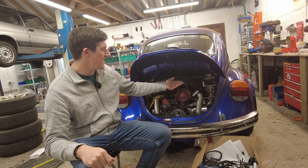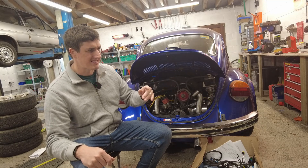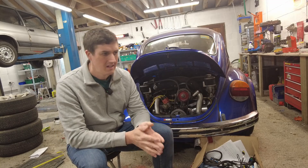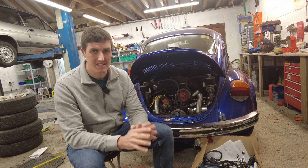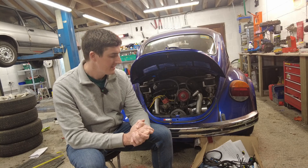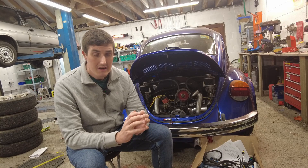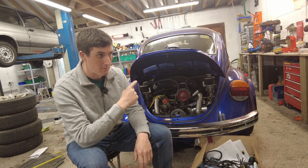It would be difficult to reverse the changes I made to get them back to stock, and even if I did there'd be a lot of issues. Rather than spending money replacing the IDF carburetors with new IDFs or trying to get them running and still having all those compromises, I decided to try the EFI thing — as much out of interest and curiosity as anything else. I know there won't be any compromises, and when it's tuned correctly the fuel injection kit will be transformative on this car.